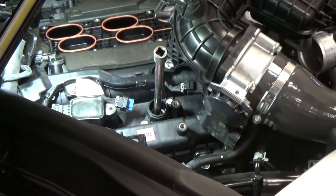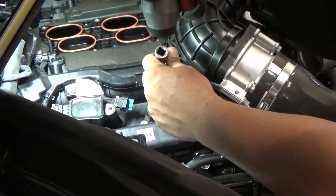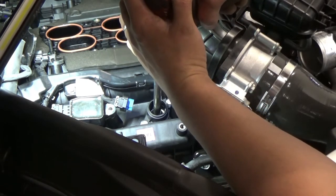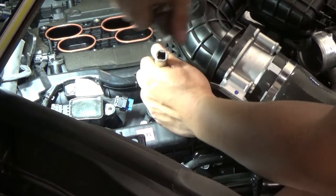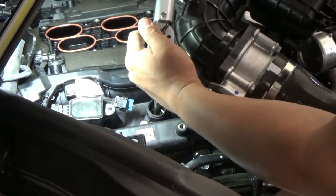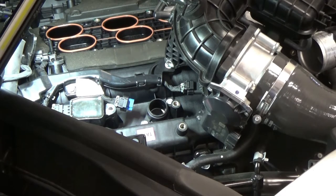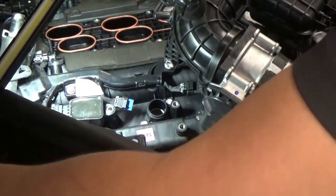Tell me it's not going in. I'm just gonna use the gun, but very, very slowly. Okay. And can I try this? Okay. Let's start that. Usually I'll torque the spark plugs at 18 foot-pound. So, okay. So that's good now. Question there is, is it all the way in there? But it torqued to spec. That's good now.